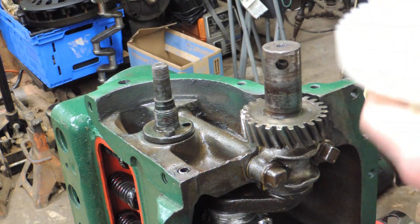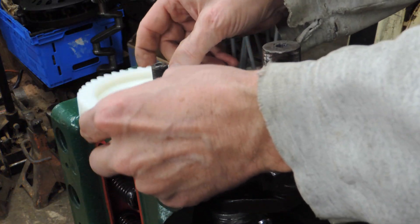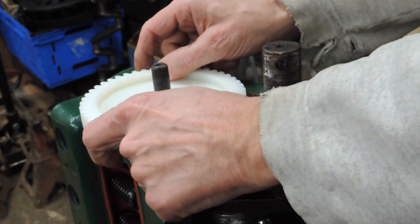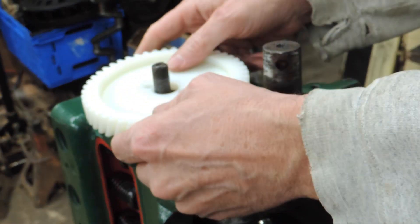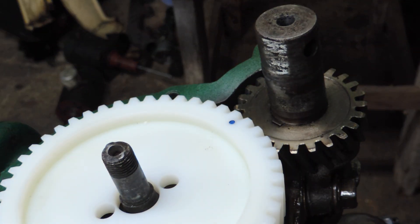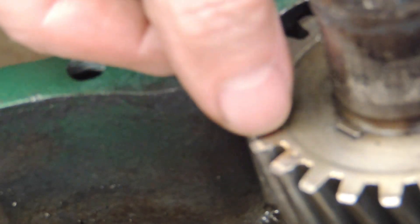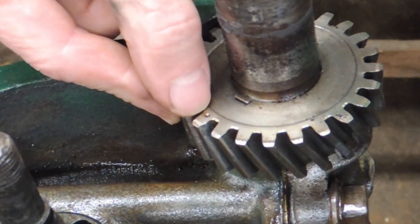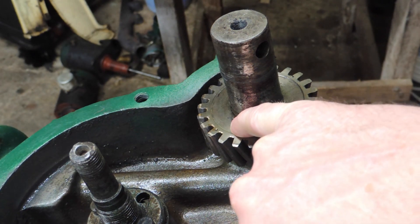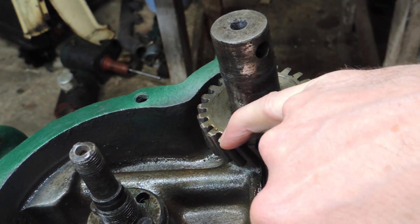I'm still not happy about it, clearly, but whatever — he can have it. And there's a seven right there, so it's not seven and a half as advertised on the box, it's seven. The dot needs to line up with the other dot. I'll get you a shot in a second and we're going to need to turn this to get it in the proper position. You want this dot to line up with that dot. The tripod doesn't go up any higher, but I'll see if I can get an overhead view. There's a dot right there — it's right in front of my thumbnail. I can fix it in post. The dot is not lined up with the keyway — the keyway is kind of half in the valley and half on this tooth. I don't know why Ford did it that way, but they did.